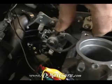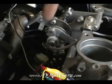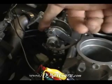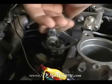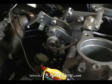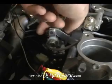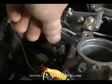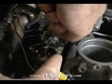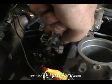So what I'm doing is, if you go back, see if the servo doesn't keep up with this, it doesn't move at all. So you'll see now what the servo is doing by keeping up with it. The servo moves this linkage here. When you turn the bike off, that linkage doesn't move at all. So on the dyno, you're going to go wide open with that, and this is not going to follow with you. It's going to stay behind because the computer has control of it. There being, it drops that limit switch out.